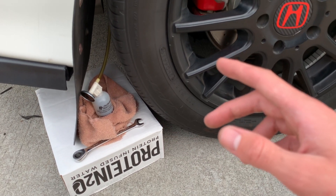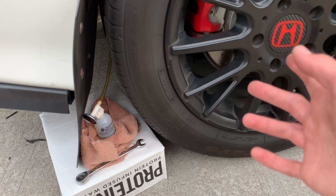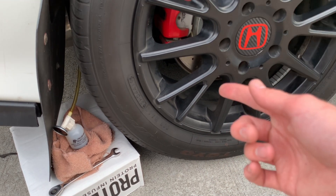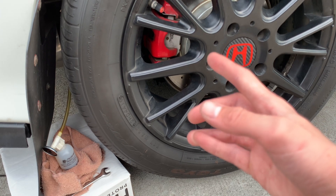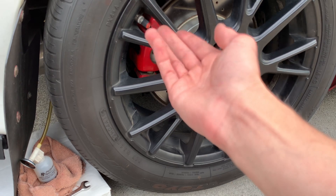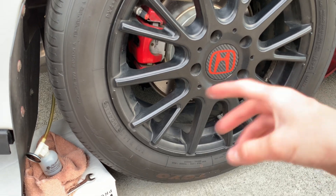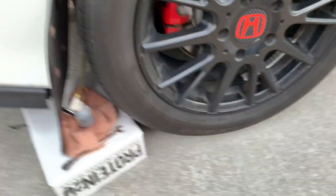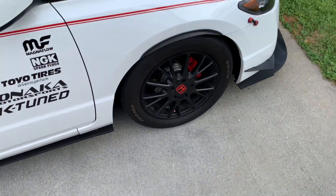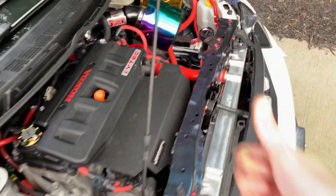That's all there is to gravity bleeding — just open the bleeder valve and attach some sort of hose to it. You can just open the bleeder valve and let it drip, but brake fluid is corrosive and will remove paint, so you'll want to put a dish under it. If you've ever painted a caliper it will run down the side, so I recommend always using the hose. Thanks for watching — that's how you bleed your brakes using gravity, by yourself, without anyone's help.